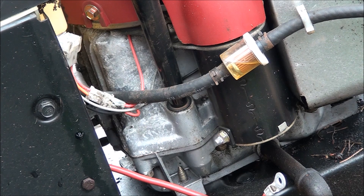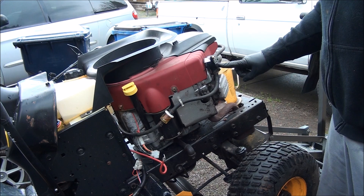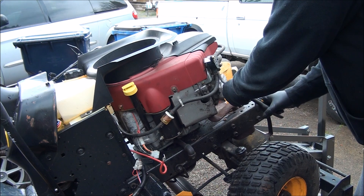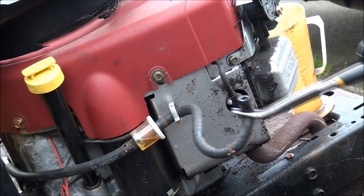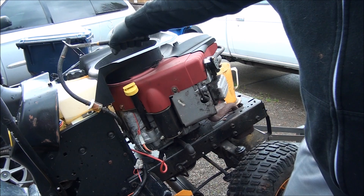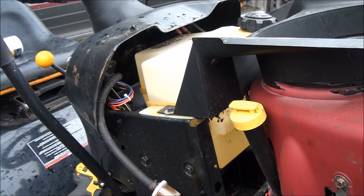The last remaining thing would be the fuel line, so we're going to have to disconnect it. This engine has a fuel pump right here. It doesn't matter where you disconnect it — there will be some gas that comes out, but as long as you keep the tip of this fuel line above the gas tank, no gas will flow out. This little clip you just pull right out. I'll tuck the fuel line back up in there for now — as long as the end of the hose stays above the gas tank, it won't spill out any gas.